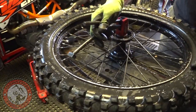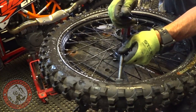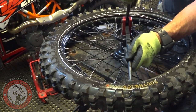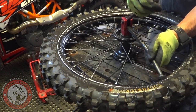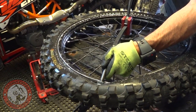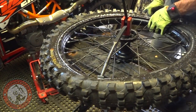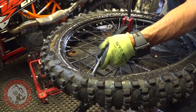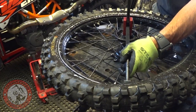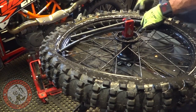Then I go the other side of the rim lock, back over here. You can see how easy it is — it's almost effortless. The other cool thing is you don't really mess up your rim if you're careful. With tire irons or spoons you'll get big nasty marks. Make sure your tire's down on the inside of the rim a little bit — and we're gonna be getting to the hard part here in a minute. Add a little soapy water.